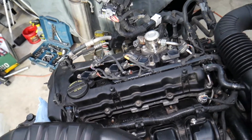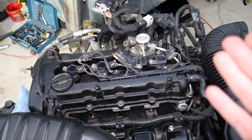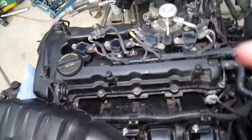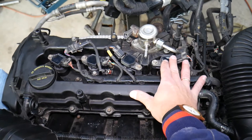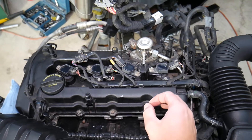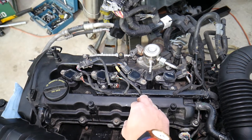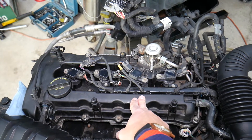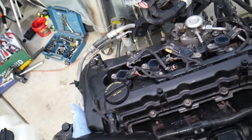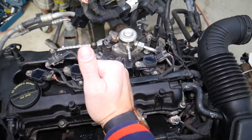When you scan the system on a Kia and get a code — let's say a fuel trim system that's too lean on bank one — let's first talk about the four cylinder engine, because that's the majority. Bank one simply means your cylinder head, because on a four cylinder you only have one cylinder head. The codes are generic, so a code like P0171 will relate to fuel trim being too lean on bank one. For four cylinder engines, you don't need to know anything about bank one and two — everything is bank one because you only have one cylinder head.